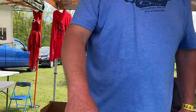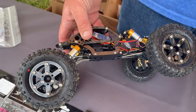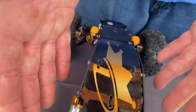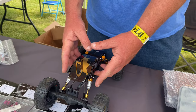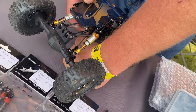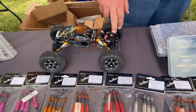We got our own link riser here, so you get more anti-squat than originally allowed by the stock geometry. All these parts are direct bolt-ons to your UTB-18 Mini Capra. I really like how it's a two-part chassis — you get that dialing there, which makes it super narrow. For the class rules you've got to have a certain width at the back, and that's smart — you're narrow at the front so if you're coming around a rock it pivots right around and comes right out. Smart design.